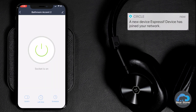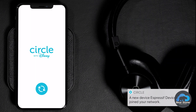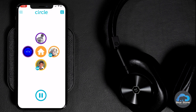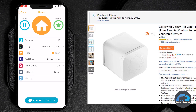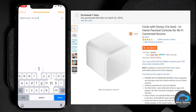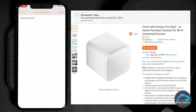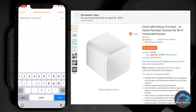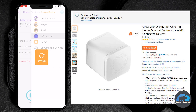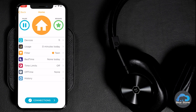My Circle device actually picked up on the switch popping up on the network. I want to show how I'm using Circle to lock down some IoT devices — like cameras — where I don't want them to access the internet at all. Rather than creating a separate VLAN, I add them all into a separate profile on my Circle device. Circle is a parental control device, but for IoT devices I can just turn off the internet, and turn it right back on whenever I need to do a firmware update. Whenever a device pops up on my network, Circle sees it and I can name and categorize it. We actually broadcast over the whole house surround sound when a new device is detected.